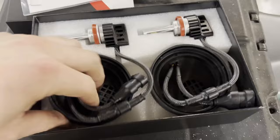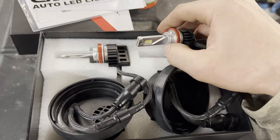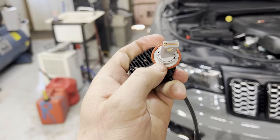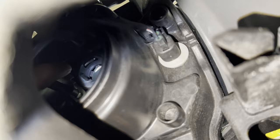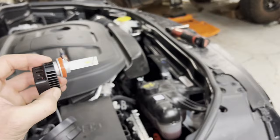Now we have the LED bulbs with new dust caps with fans built in. If your bulbs came with a little plastic protector cover over the diode, make sure you pull that off — it's just for shipping. Just like a factory bulb there are three little tabs on the mounting surface. One tab is slightly bigger than the other two. You need to line up the big tab with the bigger slot in the projector headlight housing — there are three slots in the housing. Line up the bigger tab with the bigger slot, push the bulb flush against the headlight housing, then rotate it clockwise to lock it in place.